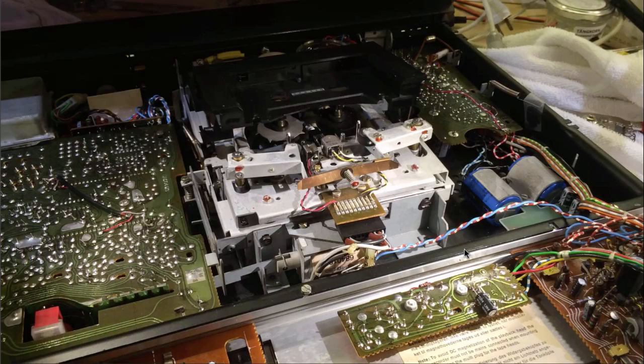Let's put these belts in. The first step is to take the tape drive out, which is a fairly simple operation. All we have to do is take these two screws out, then loosen the solenoid that is bolted against the enclosure bottom, and then we can move this bracket forward. That gives us enough room to move the tape drive forward to release it from a bolt at the back, and then we can lift it out. The only thing still holding it is a multi-pin plug inserted in the back of the tape drive.